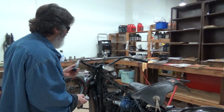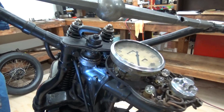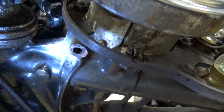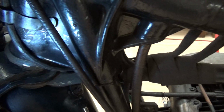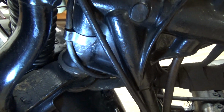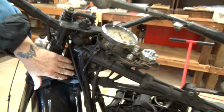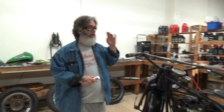So, in the neck itself, standard Knucklehead issue, most or all of them, not certain because I don't have all Knucklehead frames, had the XE35 up there. But here we have the 3 with the big check right there. So, can you get that on the film there? Yep, there it is. See the 3 with the big check. Now that's late '38 for sure, and I do believe early '39.